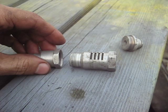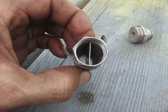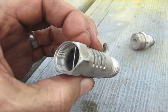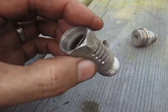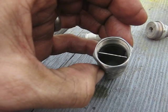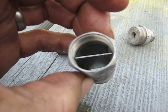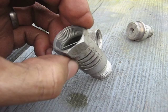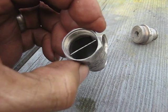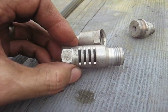That piece there screws into this. Now this piece here is kind of unique — it's got a central divider, a sheet metal one. And there are two rubber flaps. These slots on the outside, when the engine wants to intake air — that rubber, it doesn't even look a 32nd of an inch thick to me — the flaps go away from the slots and allow fresh air into the cylinder to dilute the gas-air mixture.